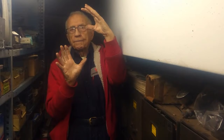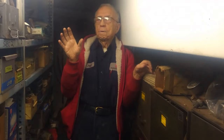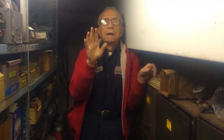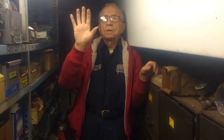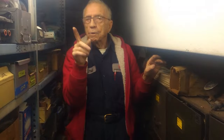But here's the trick, guys. If you're going to make those, if you make them out of plexiglass, clear plexiglass, red, yellow, or whatever, what's going to happen is the bright filament of the bulb is going to glare through one spot. There's going to be one light. Those have to be designed so that they're, what's the word, opaque, so that they're milky. You can't see the bulb through the glass or the plastic. In other words, when the bulb glows, the light is spread across the whole piece. I believe the word is opaque.